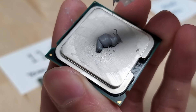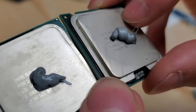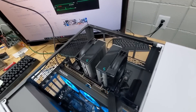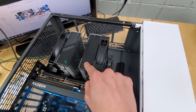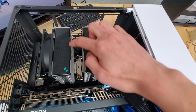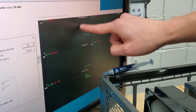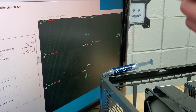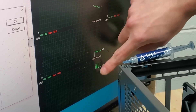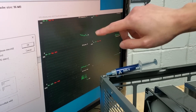Applying the new paste onto our CPU — yeah, there is a fair bit of visual difference. The texture looks just a bit more well put together. Regarding the general setup, we'll be using the same PC to test every single one of these different thermal pastes. This computer has a Ryzen 5 5600 X3D along with a DeepCool cooler that doesn't have a fan in the middle, but it will be kept consistent between every single test. We'll measure CPU temperature in the top-left line graph at 100% load, and also monitor CPU clock speed to tell us if the CPU is throttling.